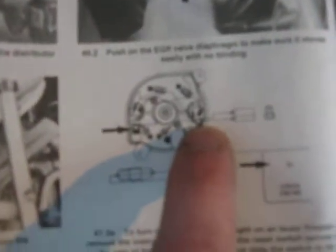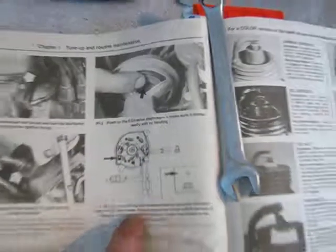But if you pull out your speedometer with your OD gauge in there and you flip it over, you're going to have to remove the OD cable from the back. When you flip it over, there's a switch down in the lower left-hand corner. So let's go have a look at it in the truck — I've got it all pulled apart so we can have a look. I'm tired of working on these plastic things.